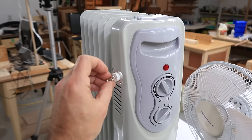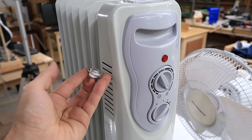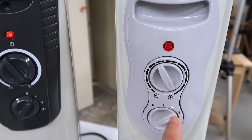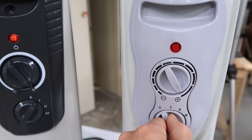The problem is these thermostats are only meant to be used for overheating — they're not meant to cycle on and off continuously. So on some heaters where this cycles on and off all the time, they break eventually. Seeing that levels 2 and 3 on these heaters are unsafe and useless, I've had the idea of changing the wiring a little bit to add a level that is between 0 and 1.